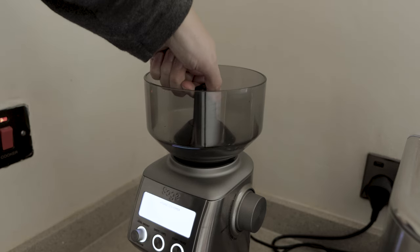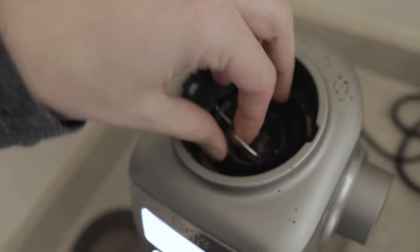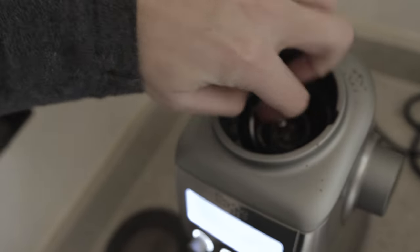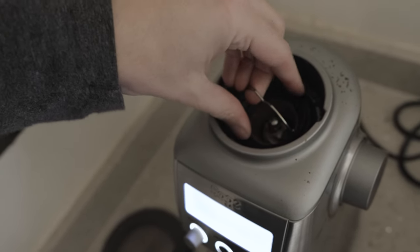The manual says 1 to 30 is the coarseness required for espresso, although over around 12 seems a bit too high. Percolator is 31 to 45, filter is 46 to 54, and plunger is 55 to 60. There is also some adjustment in the burrs themselves — you can take the hopper off and manually adjust the coarseness to suit, though I haven't needed to and it seems like quite a niche requirement. To access the burrs, take the hopper off, twist the burrs to unlock, and lift them out. You'll also need to do this when cleaning.